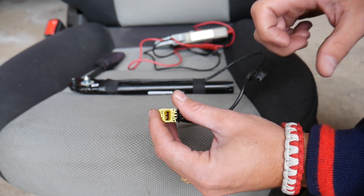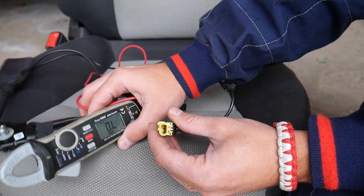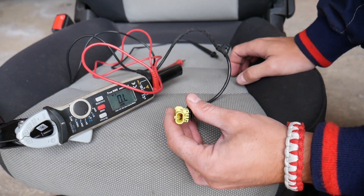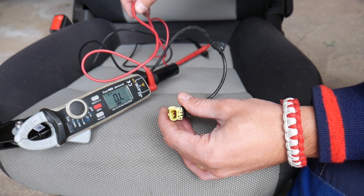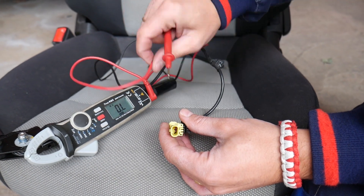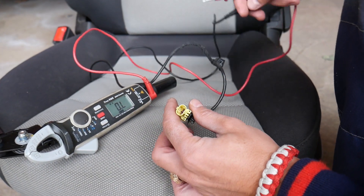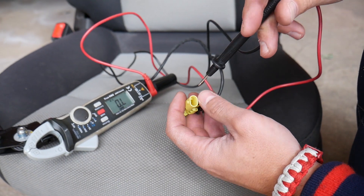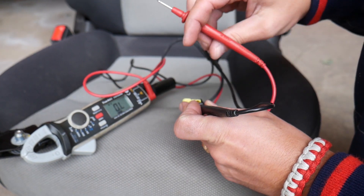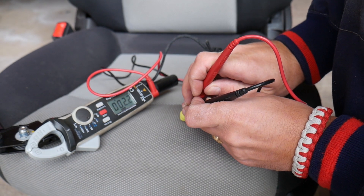We will need to go ahead and use the voltmeter. If you're on the market for a really good voltmeter, check it out — the link will be in the description of the video below. We have it set at ohms, it's reading ohms, and now we need to test the pretensioner. It doesn't matter which way you go with the red and the black lead. We are waiting on a reading.